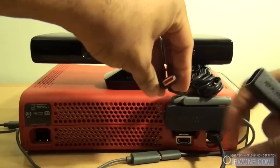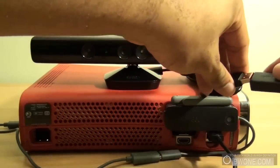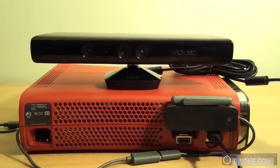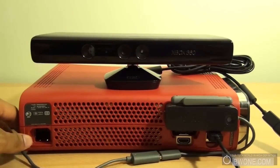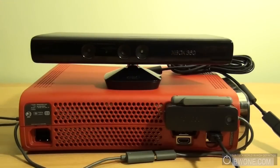You just unplug this here and that's the Kinect port — that's on the newer Xbox 360s. On the older ones this won't work. You have to use this adapter and sneak your Wi-Fi adapter around to the front, then plug in a USB in the back. You can probably also plug it into the front USB as well, but this is how the directions show you to do it.